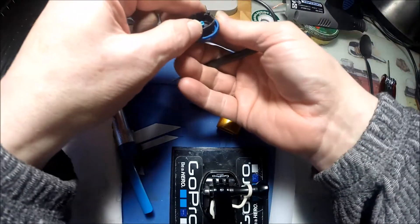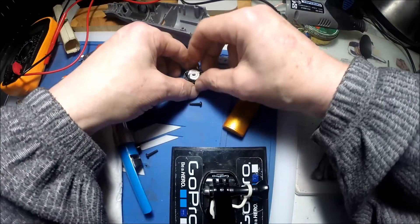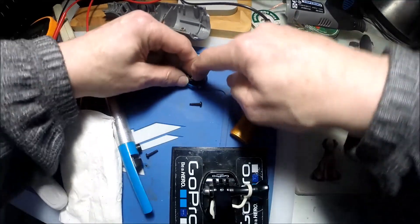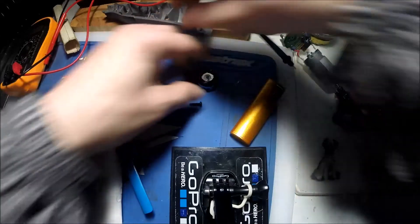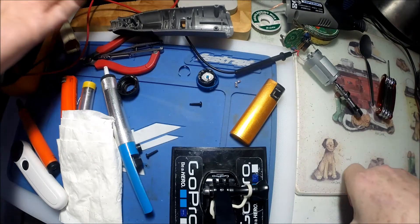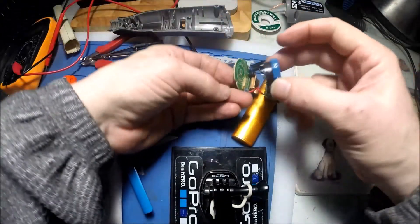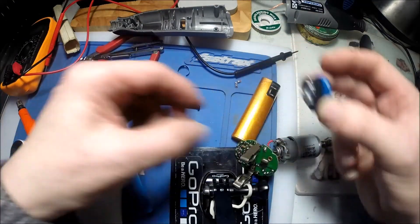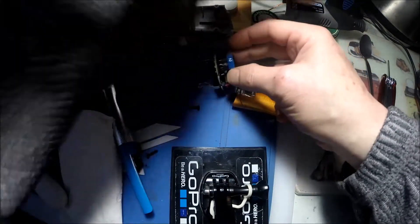That's dropped in, and I'll turn it back to eight and put my potentiometer back in. Now, you won't need to melt that back over because once it's in the housing, it sits in this groove anyway - it's not going to go anywhere. I pushed all the connections up against the circuit board, took the solder off, then pushed them up against the circuit board where I took it off, and connected the battery.